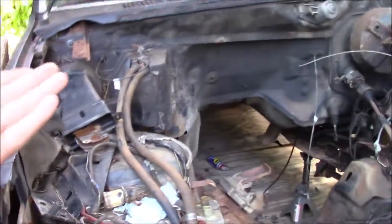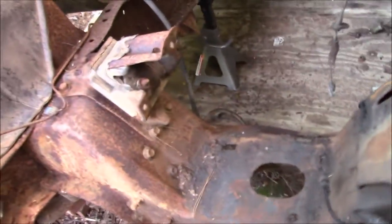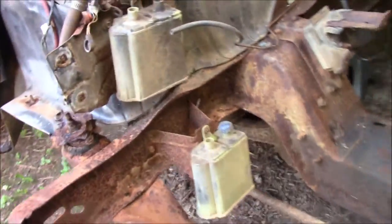We've got to sandblast the frame and do a little bit of welding, but nothing too tragic. Finding a donor truck is a good move for a project like this — sometimes it's cheaper than doing all the metal work yourself. I still want to get the steering column out of this thing, which is basically just one bolt and it can pull through. We'll probably redo the rag joint and do a new steering box, new pitman arm, idler arm, and new drag links. These drag links aren't the worst I've seen, but this truck's been sitting forever so all that's getting replaced.